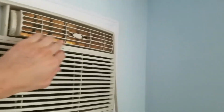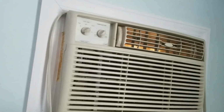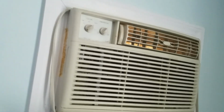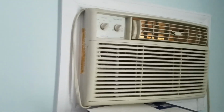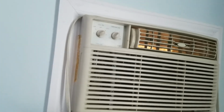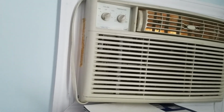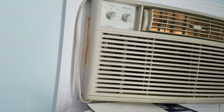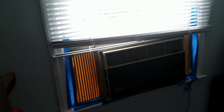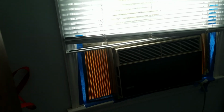but if you hear that noise, obviously the fan motor's bearings are shot. This is when Electrolux started building Frigidaire units, and they got cheaped out. Now I got cheap ass fan motors, which the bearings wear out after 5 years. And this noise is unbearable, so I just couldn't take it, so that's why I got this. Much quieter running unit, well now anyway, since it's got new thrust washers.